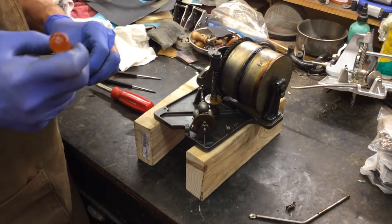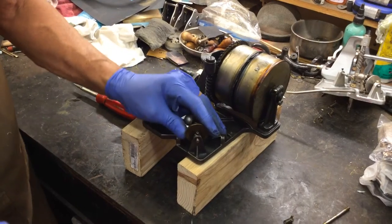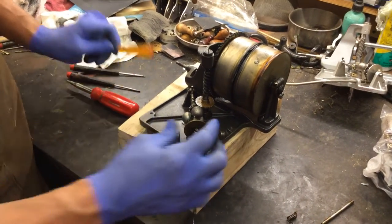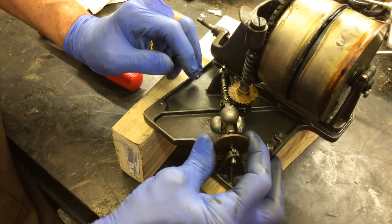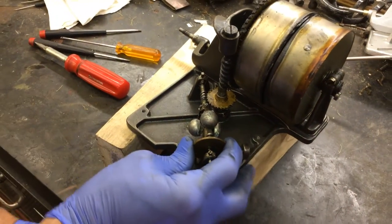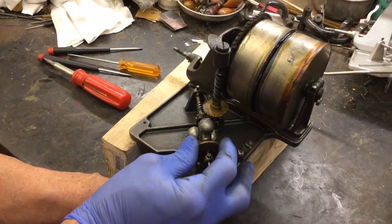Should you have made sure the spring barrels ran down first? Yes — you want to make sure the spring barrels run down. But I held on to the governor when I pulled it out. Because if there's still tension, this is going to turn. But you can control it by holding it with your finger. Then you can reach in here, grab the spindle shaft, and just let it slide between your fingers.